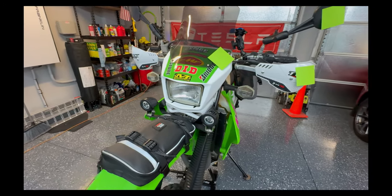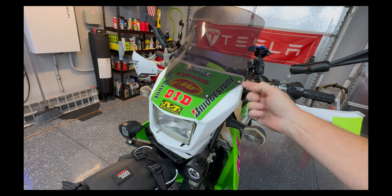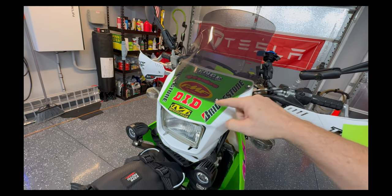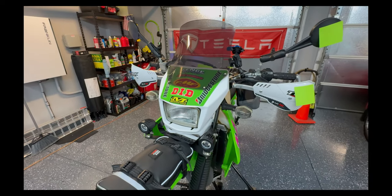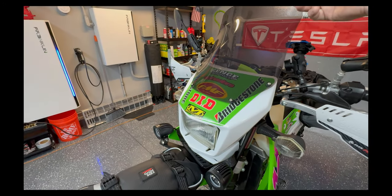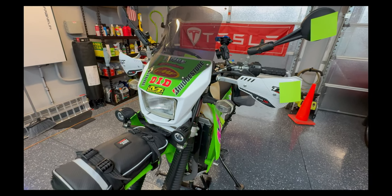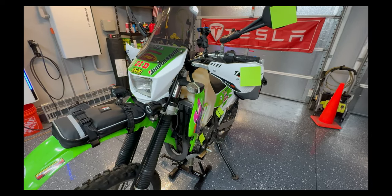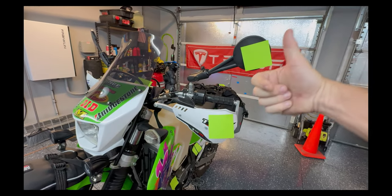The windshield is an Amazon product that comes with mounting hardware — the typical collapsible rubber that expands as you tighten it. You mark your holes, drill them, install it, and you're good. I put little spacers under mine because I wasn't 100% happy with the fit, and that cured it. It deflects air at about eye level, which is fine — it was meant to keep wind off my chest more than anything, and it's doing that. Turn signals are stock — no reason to change them unless they get broken off-road. Double Take Enduro mirrors — gotta have Double Takes.